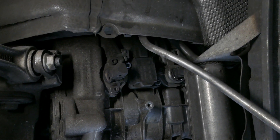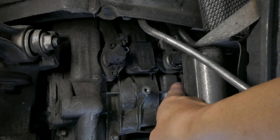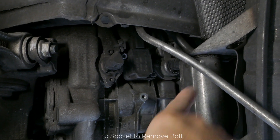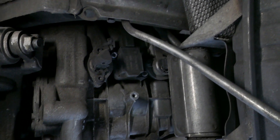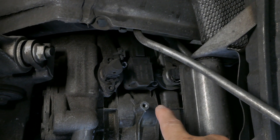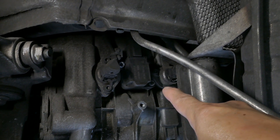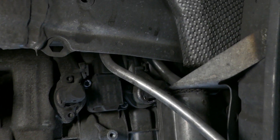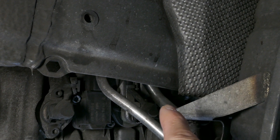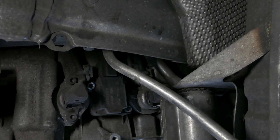The first thing I did here — you guys will remember there is a little mounting plate that went across the long way. I went ahead and removed the two bolts; there's one back here and one toward the very back. As you can tell, you have access to the most forward-facing spark plug. Space is still pretty tight — this one definitely looks easy to do. The other one is back here, which is the middle, and then you've got the one that's all the way to the rear of the vehicle.